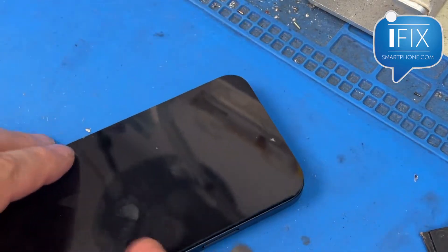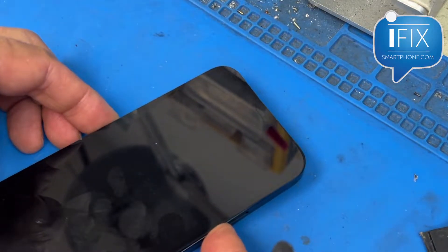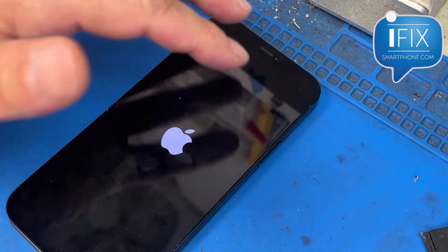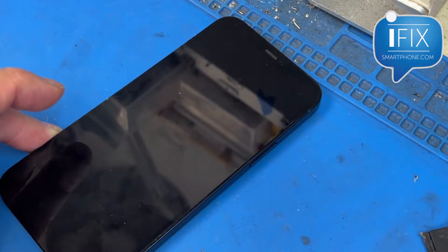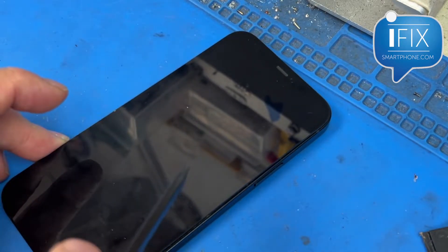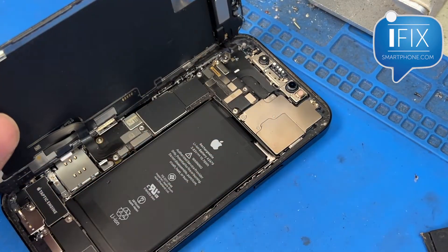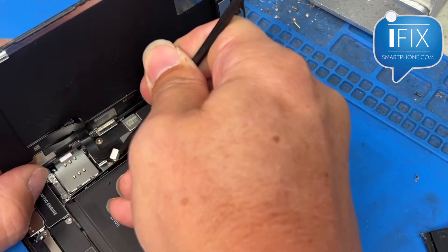The ambient sensor is not connected. You see the Apple logo on screen — so this definitely means the display is fully functional. You can actually rule out the display malfunctioning, because if the display was bad you would probably see some distorted image or you would not see the Apple logo at all. As you can see, same thing — phone is on, just don't see anything — so we can actually identify that the proximity sensor has gone bad.